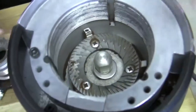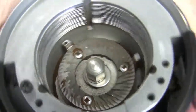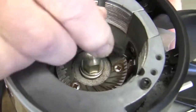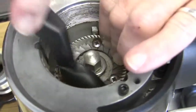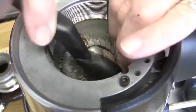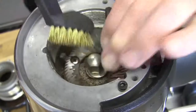The same thing on this one down here — these are going to correspond. Whatever nicked this one is going to nick that one. You'd do the same thing down in here where this is the chute — kind of dislodge anything that's in there, and it'll come out the other end through your chute eventually. How often should I take these guys apart? If you're using an oily bean, take this thing apart probably every couple of months or so; a non-oily bean, every six months or so.